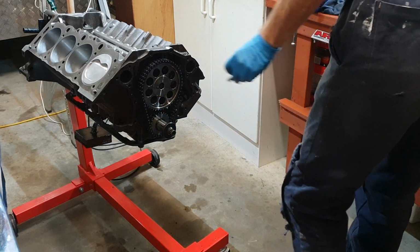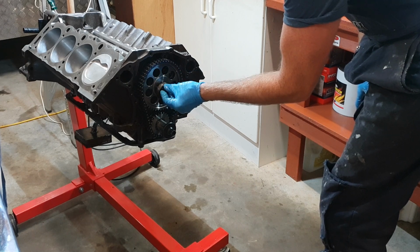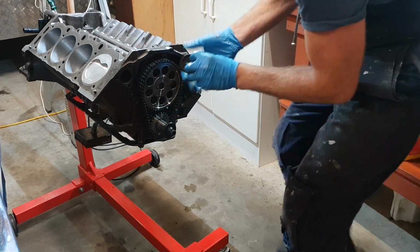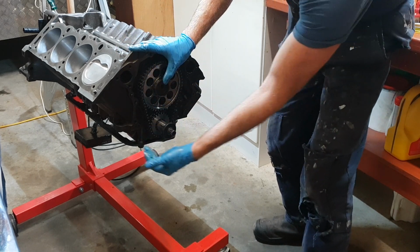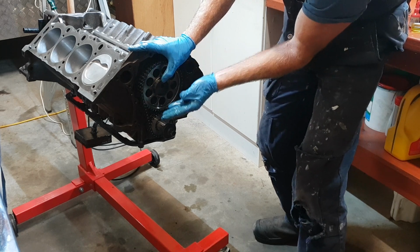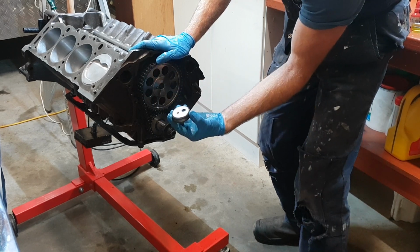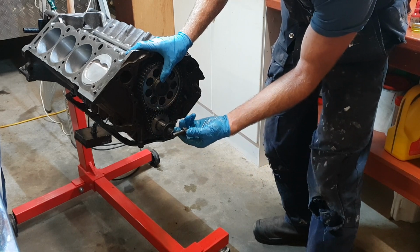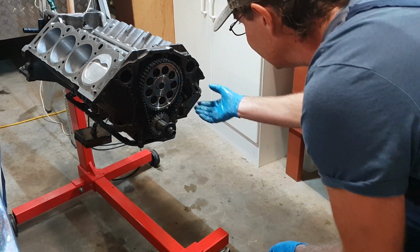I like to put a little bit of Loctite again on this. I'll nip that up. I'll read up on the spec on that one actually, but I'd like to know what that one is. And actually, I'd like to know what the other one is. But there's a bit of Loctite on it. This is the actual cam for the old fuel pump. So when you've had the fuel pump, you'll have a leg come out, and this rides off the fuel pump because it's a cam, and it pumps the fuel. So that's what that is. You could probably modify it a little bit, but why bother? It seems it's no issue. Like I said, a little bit of Loctite on it just to keep it snugged up. And that's it for the cam installation.